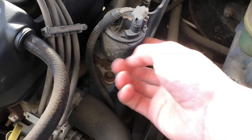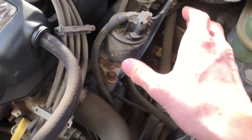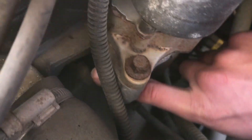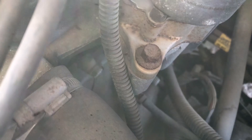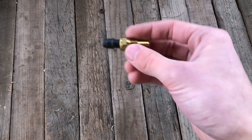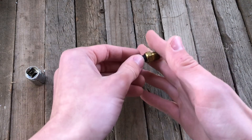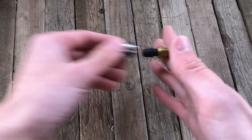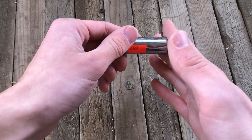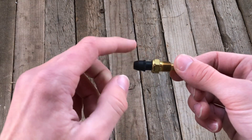Now this thing is in the way, and it wasn't in the way in the SL1, presumably because it was located slightly different. But right down here, that little sensor — you pull this connector off and then unscrew it. For the sensor, we're going to need a 13 millimeter bit. This one from a basic socket set is not long enough, so you're going to need a somewhat elongated 13 millimeter bit that can actually go over top of this plastic connector.